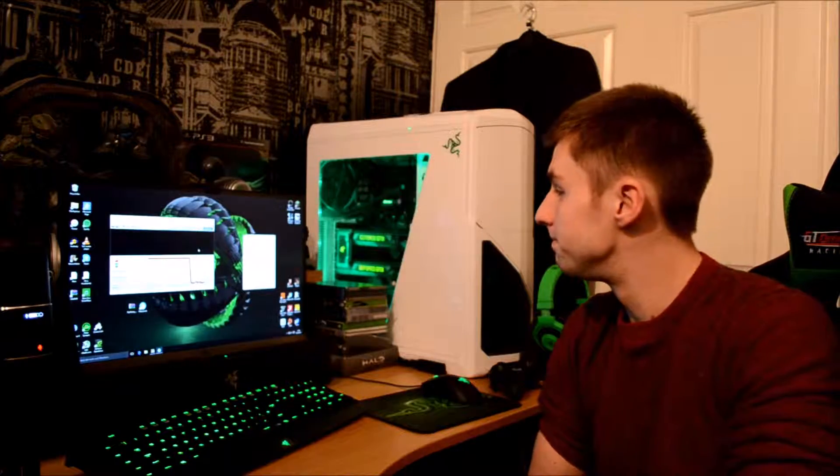Just done a stress test at 100% usage — 4.4 GHz at 1.27 volts, with a 140W TDP as the base. I'm probably drawing about 180 watts just from the CPU with that overvoltage. With fans turned down — I'd say sub-500 RPM because it's absolutely dead silent — we had the hottest core at a beautiful 76 degrees. I'm perfectly comfortable with anything under 80.